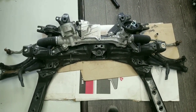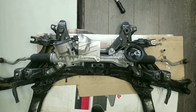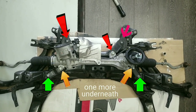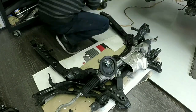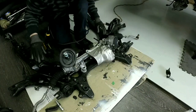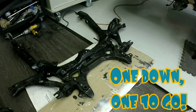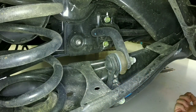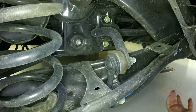Alright, the subframe is out, and all that's left to do to get that front sway bar out is to remove the steering rack — just removal of a couple of bolts. Then we'll remove the 12 millimeter bolt on the sway bar end link. I'd suggest you undo the end links first to relieve any potential stress that might be on the sway bar — it makes the removal that much easier.